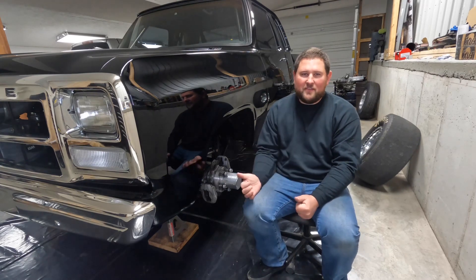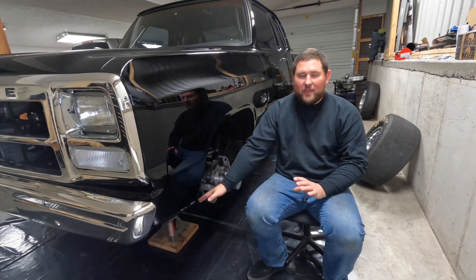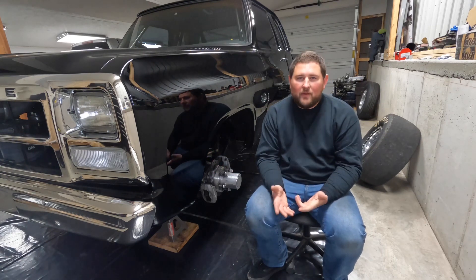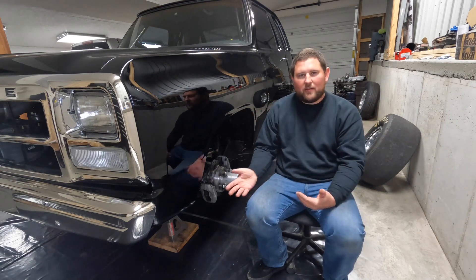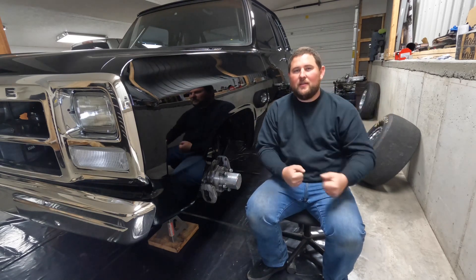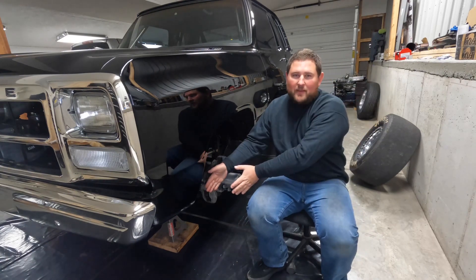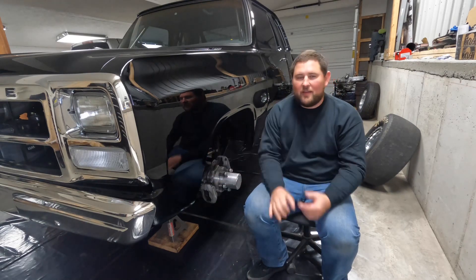The first thing we're going to address is the steering in this truck. If you've been following along since last winter when I talked about front axle stuff and steering ratio, you know that I have a quick steering ratio gearbox currently, and that is not ideal for trying to go straight down the drag strip. The quick ratio steering box gives you more nimble turning — less wheel input for a big move — and that's the opposite of what you want on a race-only truck. We want a lot of wheel input to make a little bit of actual turning.